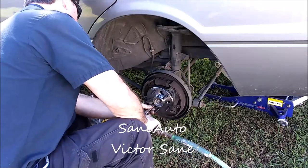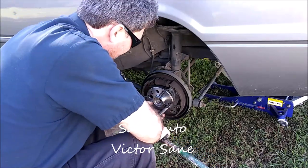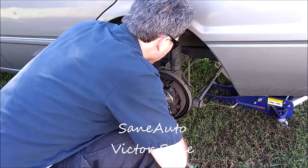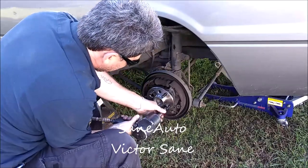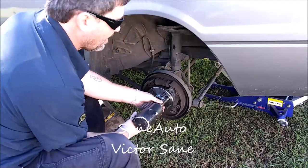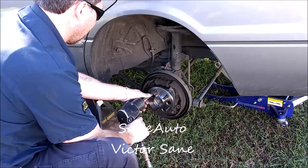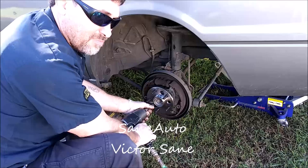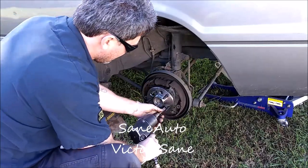And that's not all the way tight. Even though I started them by hand, I still like to go around. Run them down a bit and then cut back around for another pass for my final torquing. That way, if I feel anything wrong with any one bolt for any reason, I can stop, take things apart, see what's happening before doing any damage.